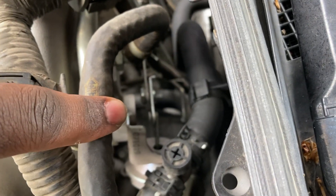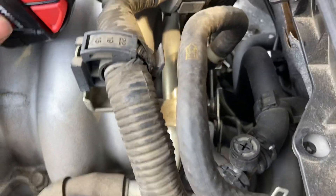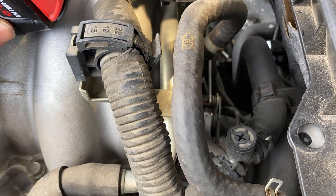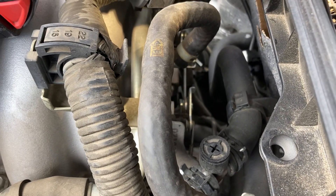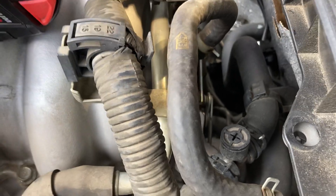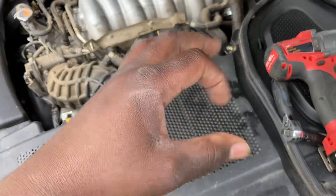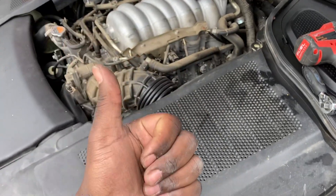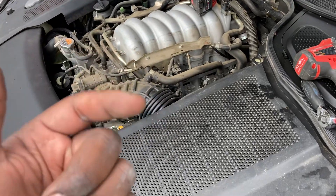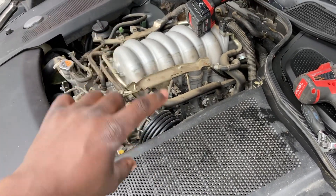Did you see it open up immediately? Let me get a flashlight — although it's daylight. Could you put it in reverse? Did you see that? Put it in neutral — it opens up. Could you put it in D? There you go. So, what happens is that right now, back to neutral please — when it's idling, the idling status, which is either park or neutral, regardless of RPM, it's going to open those flaps. It wants idling efficiency. But then, when you start moving — when you're in any other gear, any moving gear: reverse, drive, and any of the manual gears — it closes the flaps so that you have long runners.